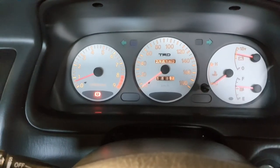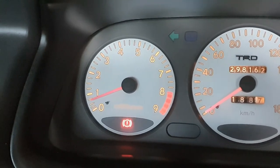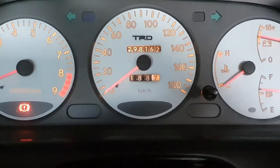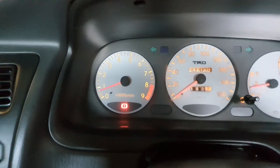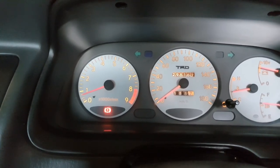So this is the revs at cold - I may have to make that hole fractionally bigger, so it's just fractionally up. We'll wait until the engine gets warm and we'll see where the revs move to. The engine's now warm and it hasn't really crept up much at all, so I might have to pull that washer piece out and drill a fractionally bigger hole. Give it another test until we get it right.